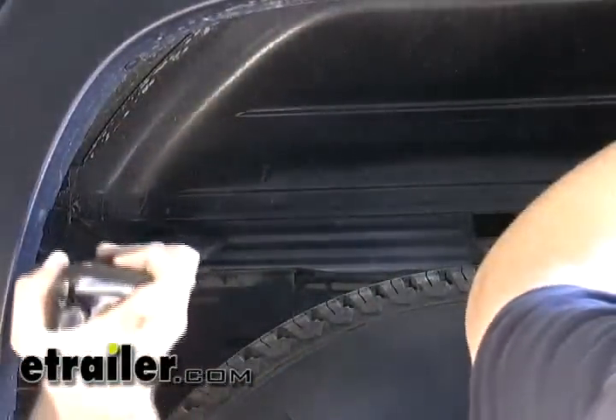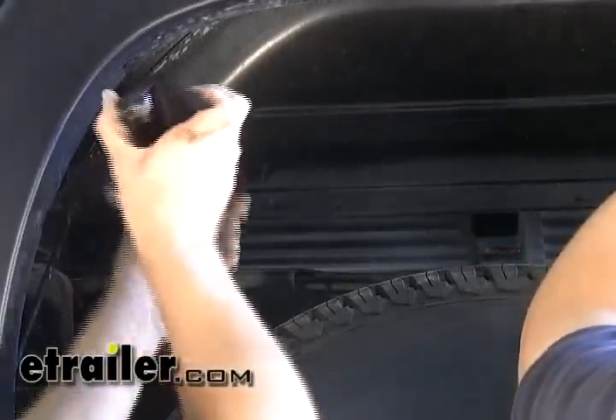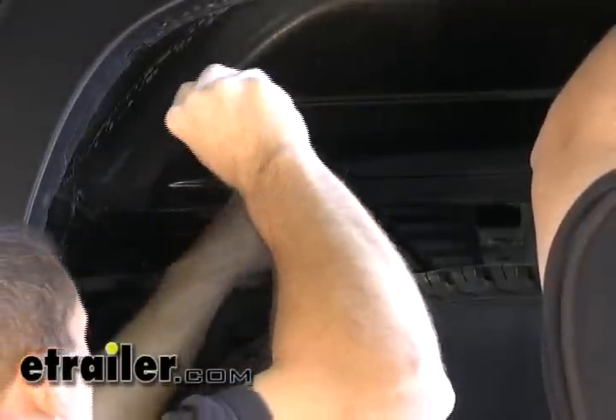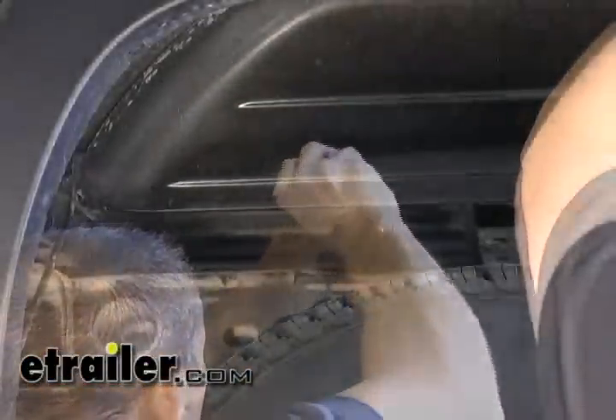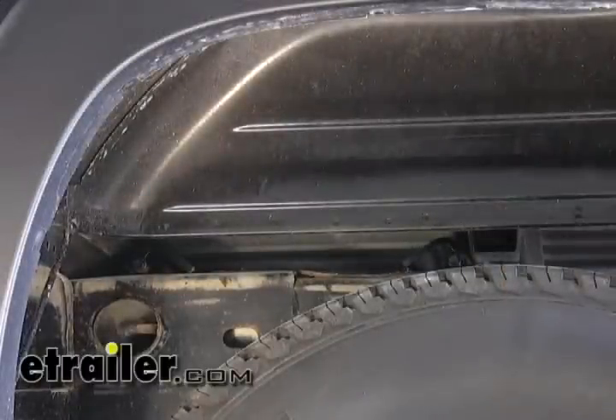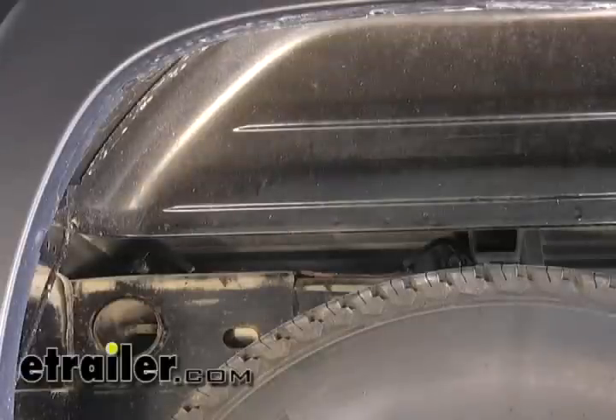What I've done here is remove all of the bolts on the driver's side. I'm going to pry the bed up and slide our cross members in across. We'll want the rear one seated against the hat channel here and leave the front one loose for the time being. We'll go ahead and set up our frame brackets now, which will help us align our cross members into place.